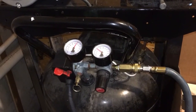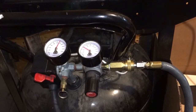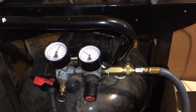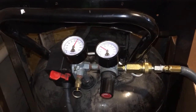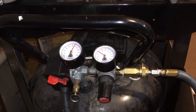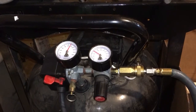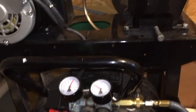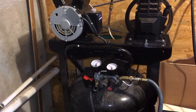I've been working for over two hours — almost two and a half hours straight today — running my die grinder with the regulator set at 50 pounds, so I can just pretty much hold it wide open and do whatever I need to do. Right now it's sitting a little over 115 pounds of pressure. Yesterday I worked three-plus hours, almost three and a half, and never got the main tank below a hundred pounds. This thing absolutely kicks butt.